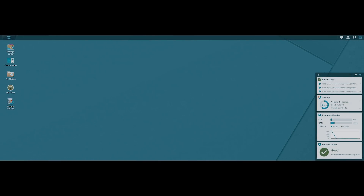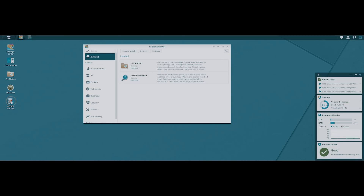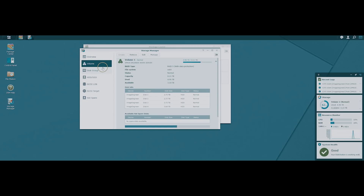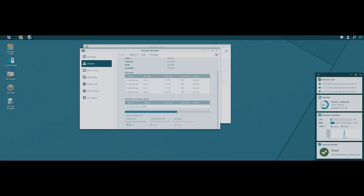Let me show you a bit of my workflow and how I structure everything. Here is the web interface of the Synology DiskStation DS416. On the left you'll see management options ranging from antivirus all the way through to multimedia servers and streaming across your home network. There's also a tool to manage your storage and check if all your disk drives are healthy. If you click on the Volume tab, you'll see all your drives listed. You'll notice that my Disk 4 is a 4-terabyte drive rather than 3TB like the rest, meaning I'm losing a terabyte of space in my RAID 5 configuration — I'll replace it with a 3TB drive later to match everything up.